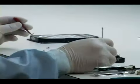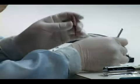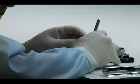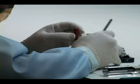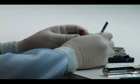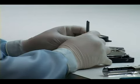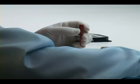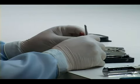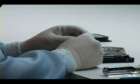There's many different kinds of drives, and for every different kind of drive, the technique that's used to remove the heads is different, because they're all designed mechanically different. Through many years of experience, you learn how each specific drive needs to be disassembled and reassembled. If you haven't learned how to do that properly, you can severely damage the media in the process of removing the head stack.